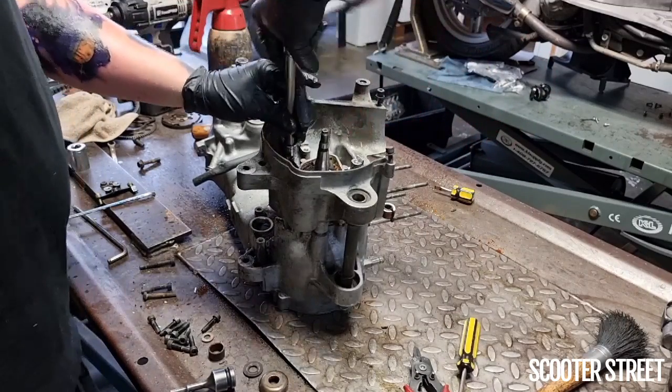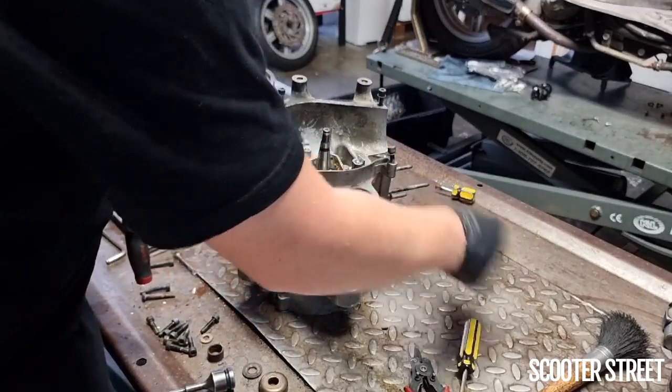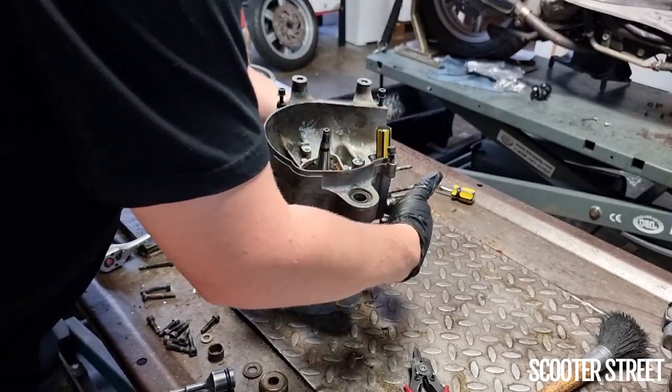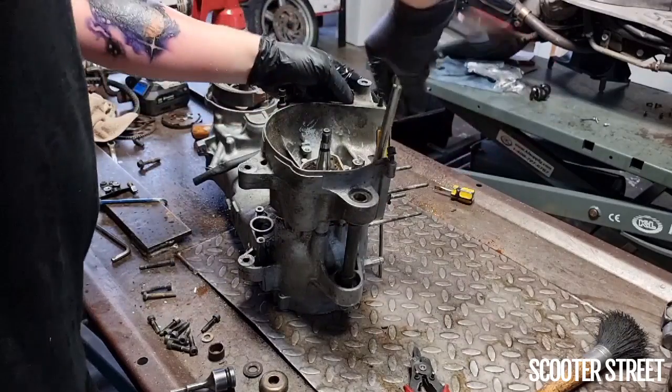There's another one. Okay, I'm starting to get fairly close. So what I'm going to do now, little trick, I'm going to sit this screwdriver through the eye of the conrod. So I know that conrod's going to be sitting in there, isn't going to accidentally get clamped in the crank casing, which would be very bad.